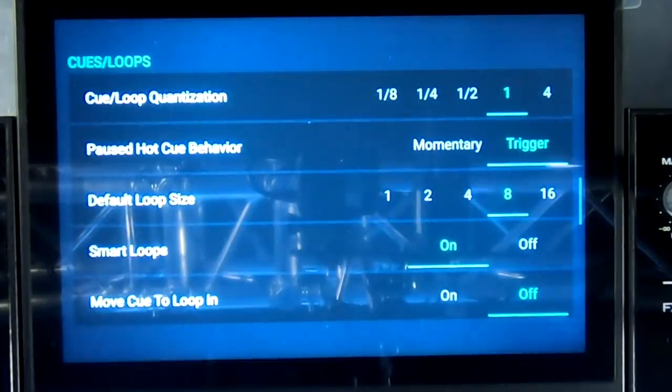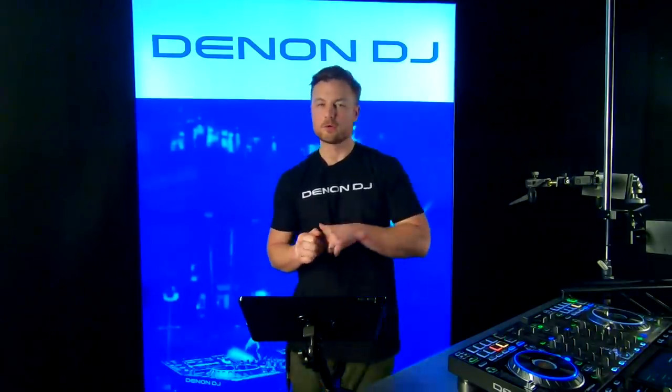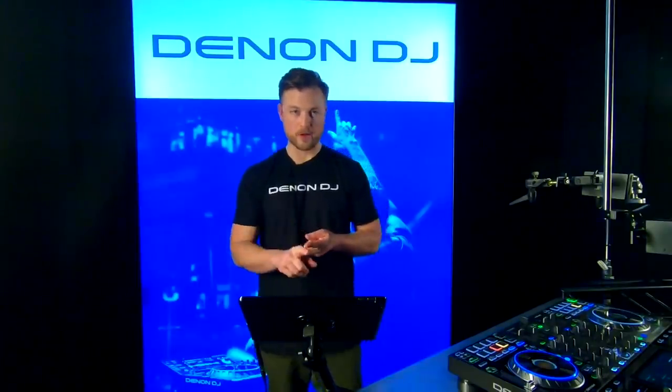Christian from Facebook asks, hello, what format do I need on the hard disk? So the Prime 4 supports FAT32 and also exFAT. So either one of those, you'll be fine. It does not support NTFS or the Apple format, Mac OS Journaled or Journaled Extended. So FAT32 or exFAT. If you're using a larger drive or a solid state drive, we would recommend that you use exFAT.